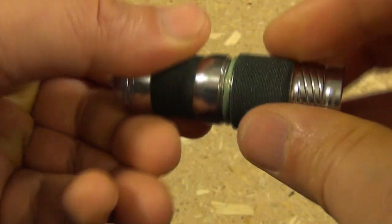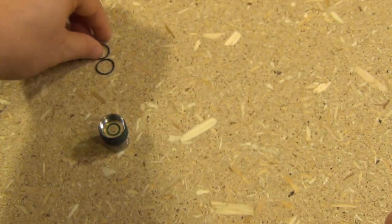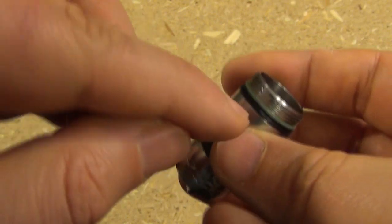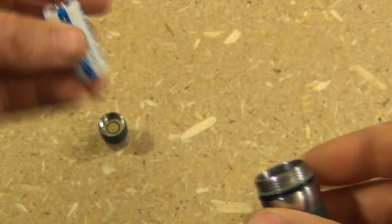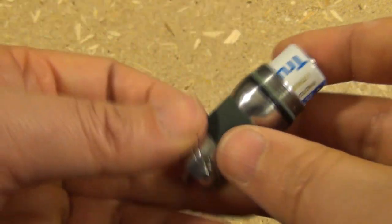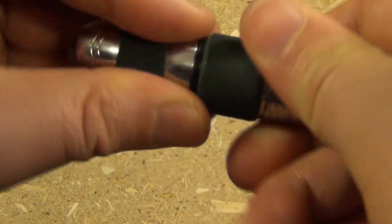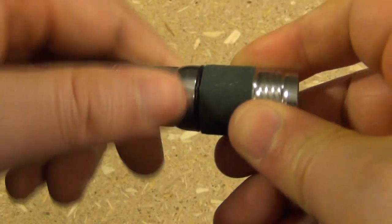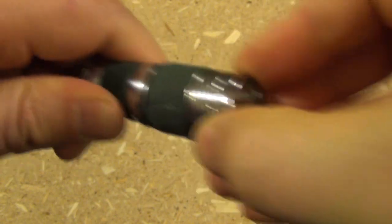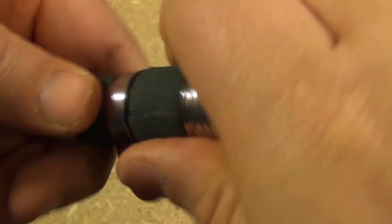Well, basically this has an O-ring, but it's just too thin. So all you need to do is add a few more O-rings. You can see I've added two O-rings there, and that's the one it came with. Many little flashlights come with extra O-rings — I have about a dozen extra sitting around, and I'm sure you can buy them separately if needed. Now if I press on this, you can see it is not going to activate, because those O-rings prevent it from depressing unless I really screw it down.